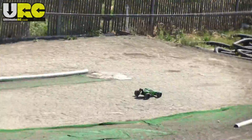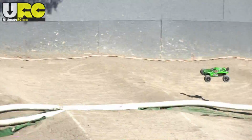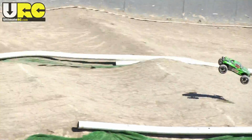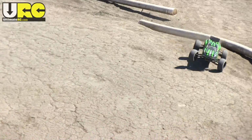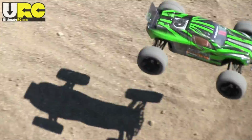On a hard-packed off-road track, I was able to get enough traction to be able to see more what the speed and acceleration is like, and also I was able to test out the jumping attitude. It jumps nicely, again with the 100 weight shock oil. With the stock oil, it would have just slapped the chassis everywhere. Like this though, it seemed pretty well composed.